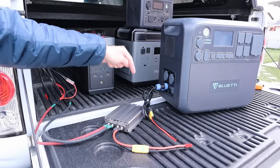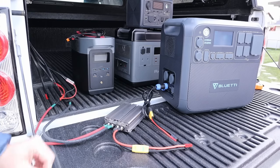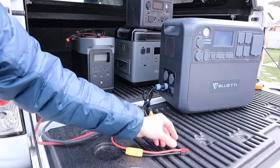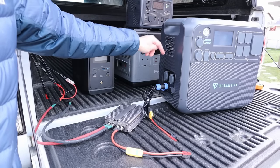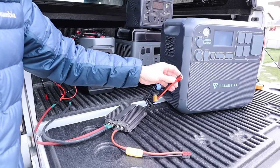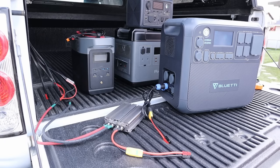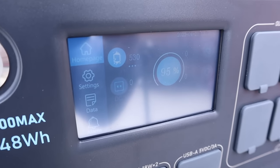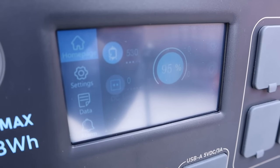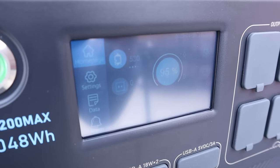In the next demo we're going to be using the 12 to 36 volt boost converter with the Bluetti AC200 Max. This is connected up to my starter battery with an Anderson PowerPole connection. With the Bluetti I'm using the stock charging cable with an XT90 to Anderson PowerPole adapter. With the engine started and plugged in, we're getting 530 watts charging input from the 12 to 36 volt boost converter — pretty good wattage on the AC200 Max.